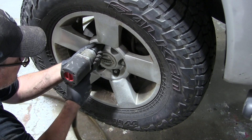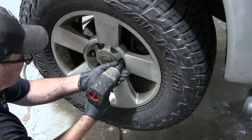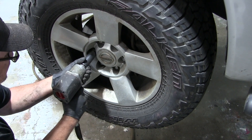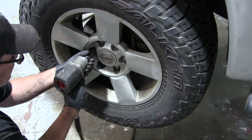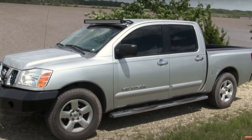I went up front and got a torque wrench and tightened everything to spec. Now I'm putting the wheel and tire on — you also want to torque the lug nuts to 100 foot-pounds. Snug them up while it's in the air, then lower it to the ground to finish torquing. Then I took it and got the front end aligned. Pretty simple process, pretty easy to do yourself.